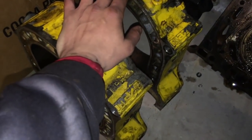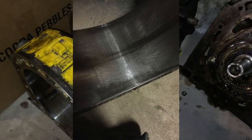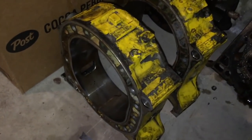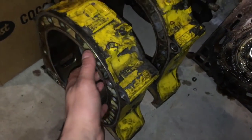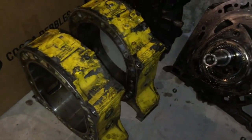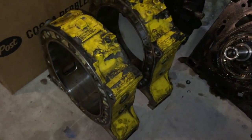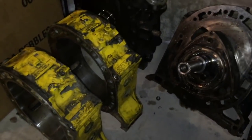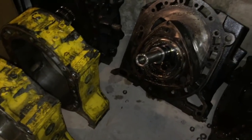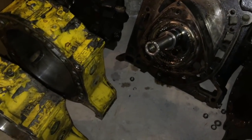With the housings, the rear housing looked to be in really good shape — a little bit of flaking in some areas but I think it was all in the combustion area, so nothing too bad. With the front housing, there's some questionable wear — well, not wear — there's like a little scratch on the outer edge, and I think it was at the end of the compression area, so it's a little bit questionable. I may end up just sending both these housings off to be resurfaced, and may send my other housing as well since I have three of them in total — all RX5 housings. I don't see anything that says any of these parts are unusable, but none of them are exactly ideal. Being that these are all NLA parts — no longer available — I'd say I'm in pretty good shape for a rebuild.